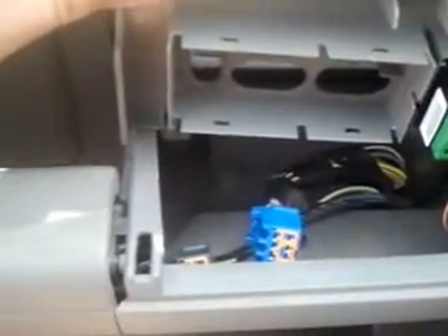You have wire harnessing in there that attaches to this piece, which is the switches — which I already have partially disassembled — but you're able to take the wiring harness off. Once you get to the wiring harness and take those off, you take off all of your switch tops just by prying them up with your fingers. Then you have these little rubber gaskets here — you take those off as well.